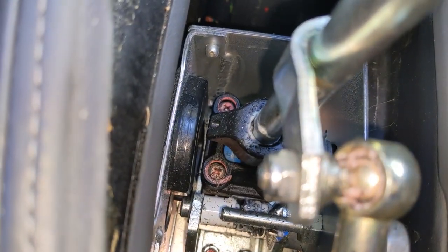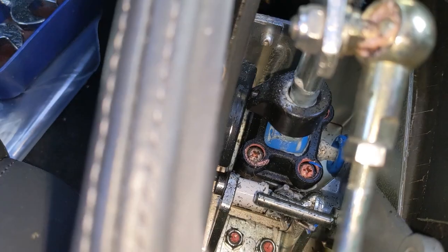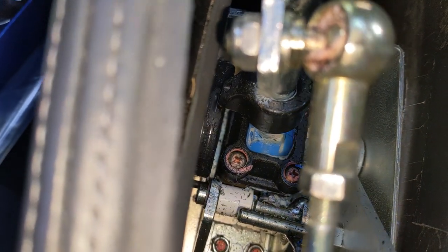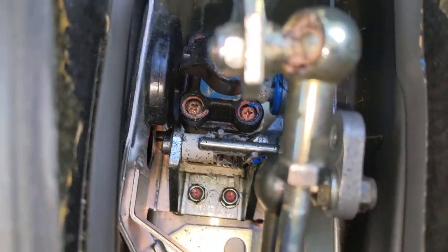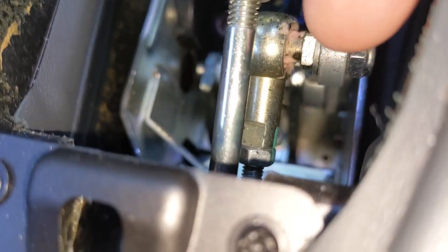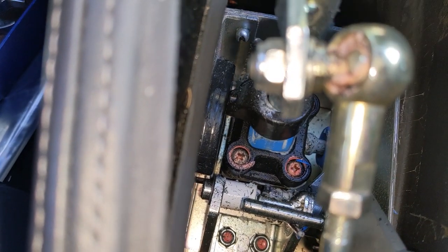I think the primary reason is that when I go into first gear, I have to bang this all the way over. This is the obstructor plate — that's intentional. When you go to first, it hits there and then you slide across it. On a typical cold day it does not like going into first or second. That plate is there because on the plane of first you lift it up and go over to reverse. What we're going to try to do is adjust the cross-gate cable — going counterclockwise to make it longer — so that when it bumps up against the obstructor plate, it doesn't hit so hard and doesn't grind as it moves across.